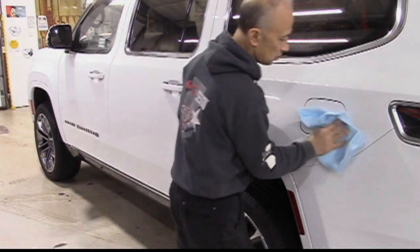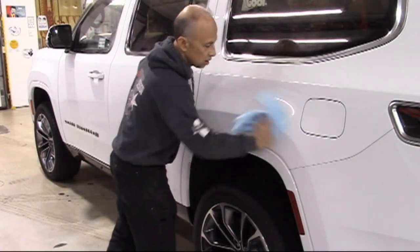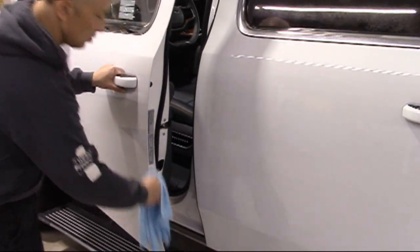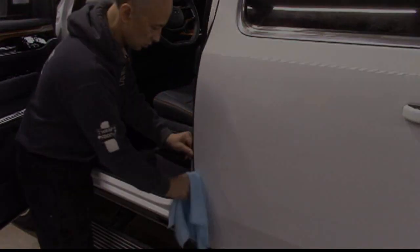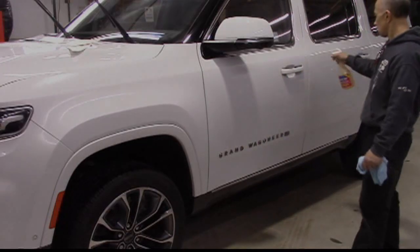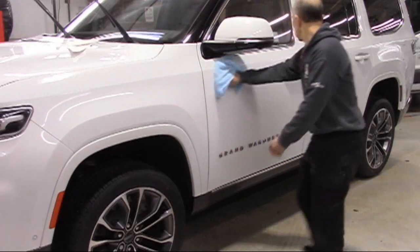With the vehicle properly washed and dry, proceed to spray the surface with a liberal amount of rapid prep or other solution that assists in removing wax, polish, or oil residue. Take care to properly clean the rear of the door edges where the front and rear doors meet. We'll be wrapping the graphic around the edges, and a clean surface will promote adhesion. Follow up the initial cleaning with another spray and wipe of rapid tack. This will sufficiently prep the surface for application.